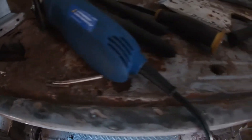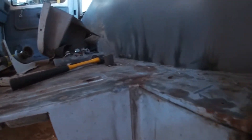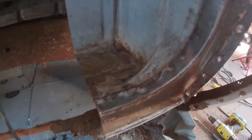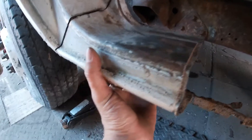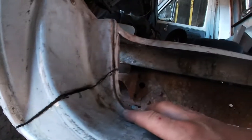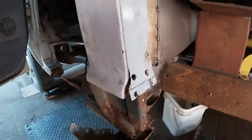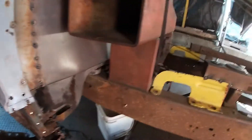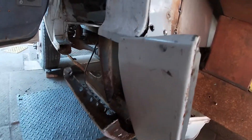We're going to have to drill out each spot weld, but it's a lot easier to drill out and it's just a thin strip. So I'm just chopping out all the old rot — all the rusty metal that's just really not going to stay. So this we're going to cut along there, try and join it along, cut that out. This is the back section, half an inch lower than the other piece so that it'll still fit. This is the previous piece and this is the new piece.